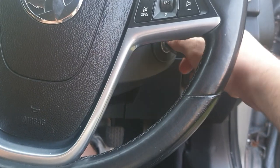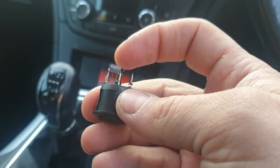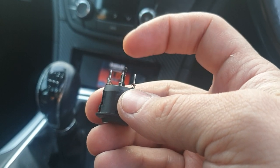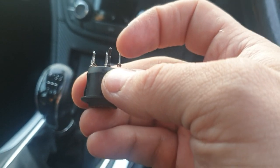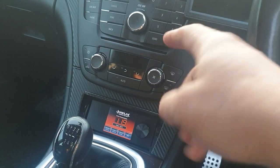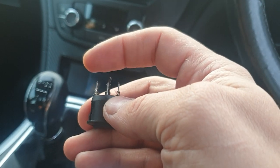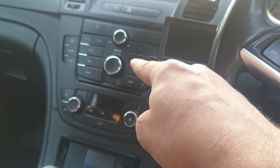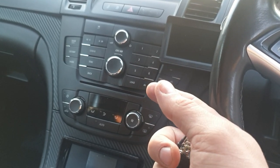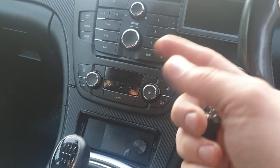Let me turn off the ignition. The middle pin is the remote wire going to your amplifier or DSP. On one terminal you put the normal remote from the head unit, and on the other you put a live wire that comes directly from the battery. Most head units - if you go from the back - have a wire, sometimes yellow sometimes red, that's a live wire, not a remote. You just piggyback from that one and run it into the switch.